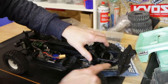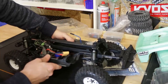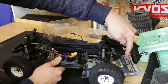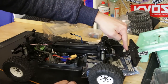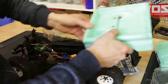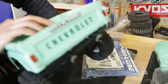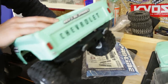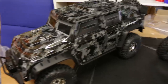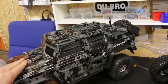On this one I cut the chassis down a little bit - as you can see here there's only one hole, and as standard you get two holes. So I cut that last hole off with an angle grinder and just used one of these front mounts upside down, and that kind of makes it line up pretty perfectly for this body shell. This body is actually going to go on this TRX4 here - this one's going to be the nice one.